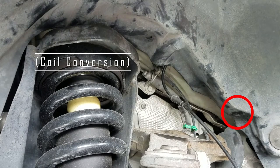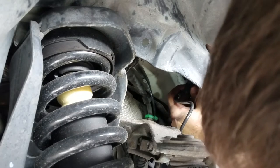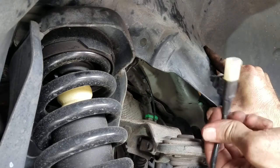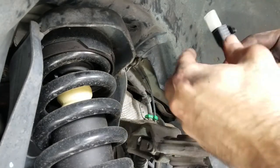To peel this back, you will need to remove an adjacent plastic clip. Once the clip is out, you can pry the plastic back and see where the sensor attaches. It is held in place by a plastic Christmas tree fastener — pull that out and you'll have a little more working space. Once you actually remove the sensor, grab your new sensor and reverse the process. The new sensor should have its own new Christmas tree fastener, so don't worry if you mess it up.